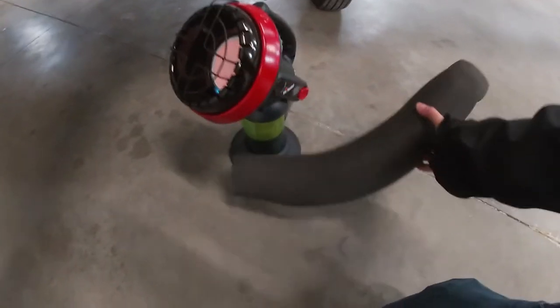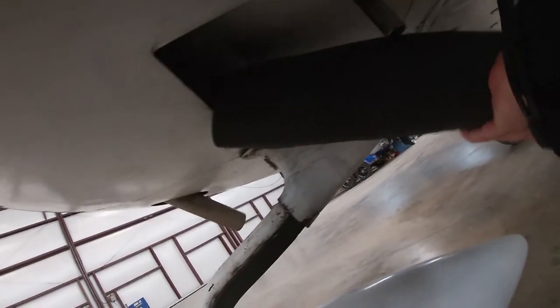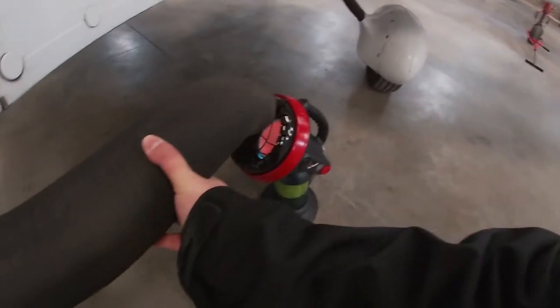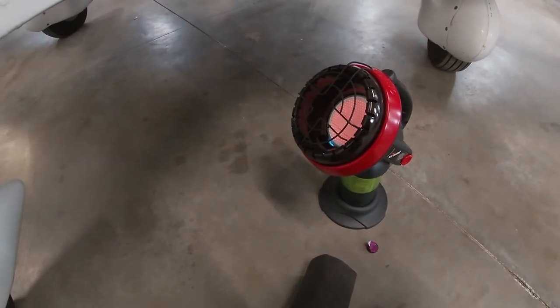I use this old scat tube and I'm going to push it over here to the exit duct and line it up. What that's going to do is run the scat tube towards the Mr. Heater, moving warm air to under where the oil sump is. Nothing's going to be touching, it's not going to be hardwired. It's pretty warm air, but not terribly hot — definitely less temperature than what the engine has to deal with.